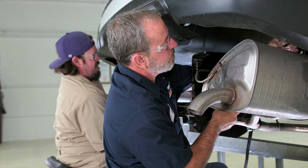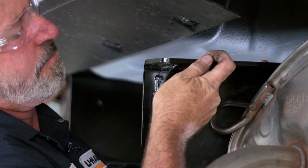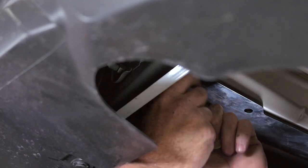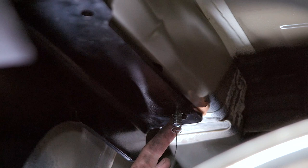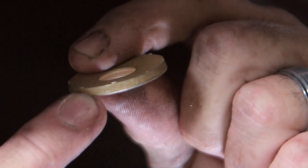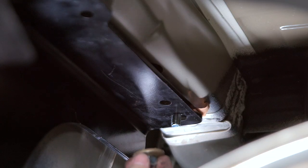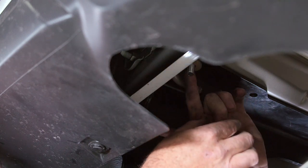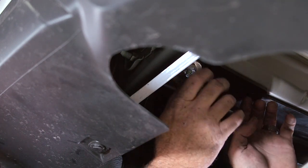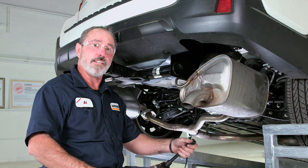We're going to go ahead and feed our bolt buddies through the forward attachment hole and the rear attachment hole. I'll take one of the bolt buddies off and put a nut on it just to give it some support. Now that we have the hitch supported, we're going to take our bolt buddy down from the carriage bolt and add the conical washer — the conical teeth going straight up to the hitch. We'll do the exact same thing on the driver's side. Now we're going to go ahead and torque the bolts and nuts down at 50 foot-pounds.